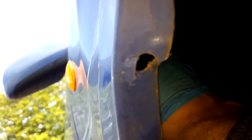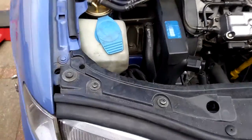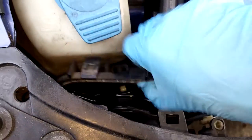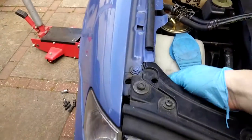As we pull that out we're going to go back in a second. The next thing we want to undo is the indicator bulb — we're going to pull the light bulb out. It literally just pulls out and we pop that to one side. Before we can even think about taking the wing bolts out we need to get part of the indicator out of the way and also the bumper. The indicator has a clip in it, so we're going to take off these headlight bulb covers so we can get our hand in — you can just see there on the left-hand part of the screen, that's the clip for the indicator.